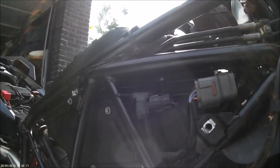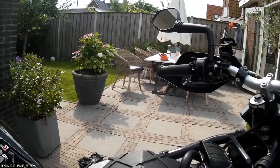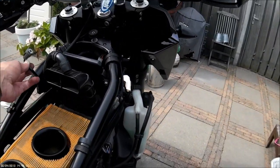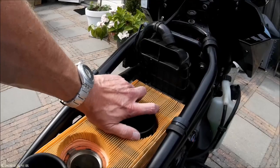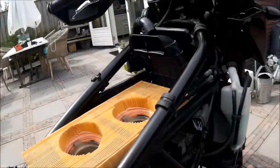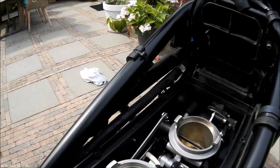Then you need to install the tank again, because the engine won't run without gas and the fuel pump needs to pump it to the engine. First I need to remove the lid from the air filter so we can get to the throttle body. Taking these parts loose — the connector, the pipe, the hose — and now we're going to remove the air filter to get to the screw used for synchronizing the vacuum in the throttle body. I've also got a new air filter. As you can see, I've taken the secondary butterflies out — this is the one we need to adjust the vacuum on.